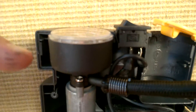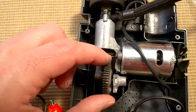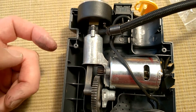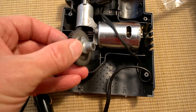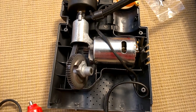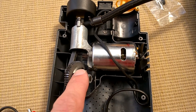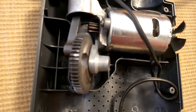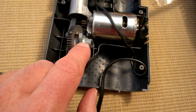It probably only pumps on the upward stroke, and there must be some sort of non-return valve so it can read pressure but doesn't leak out - each pump pushes a column of air through. And there's the breakage - completely sheared - just on normal usage. I was actually inflating a 14 or 15 inch tyre. I'd done two tyres, just checking them from about 28 PSI. I was doing the third tyre - 28 PSI up to 32 - and it sheared. So pretty poor.